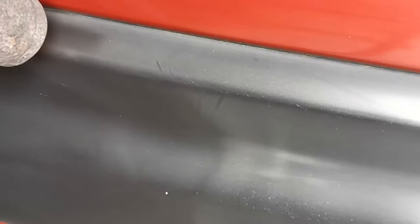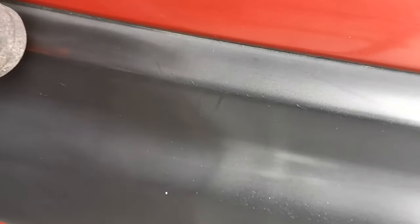I've got to reiterate at this stage — please be very careful of your paintwork. If you get too close to the paint with a heat gun it will damage it. Here you'll see how I deal with the edges of the black bumper and how I try to avoid burning the paint by gradually working to and fro the edge of the bumper slowly with the heat gun, just until you see that spread of darkness and then come away again. It's easier to do several passes than to go in too hard and burn your paint.